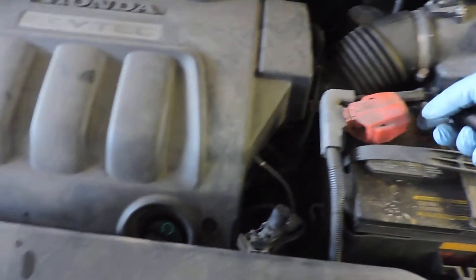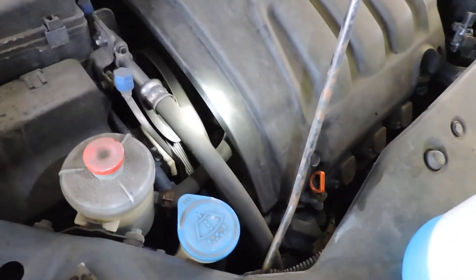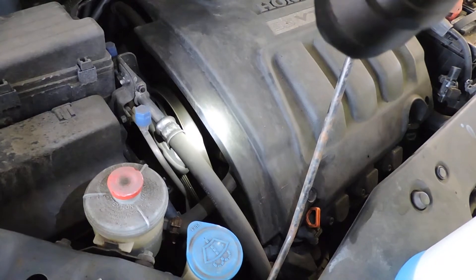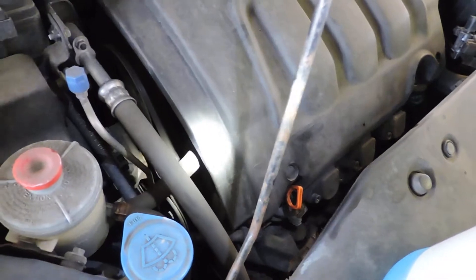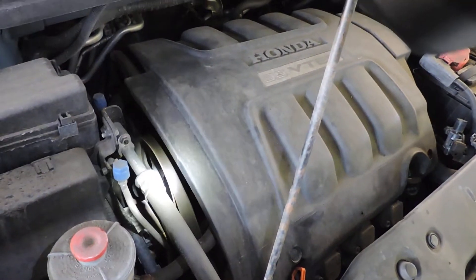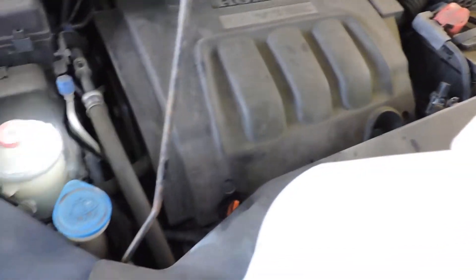I also want to make sure the battery terminals are not corroded. If they are, you just brush them off or put a little oil on them. Then take a quick look at your serpentine belt — that's your main drive belt for most of the engine functions. You want to make sure it's not too worn or cracked. They usually last about a hundred thousand miles. It may be the original on here. If it ain't broke don't fix it, because it's a fairly extensive repair — you have to take a lot off to reroute it, so that's really a job for a shop. I just want to make sure it's snug and not cracked, because if this breaks on you, you're not going anywhere.